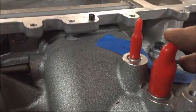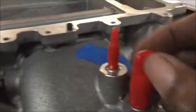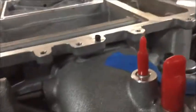Let's recap. You're going to leave this, you're going to cap this off — cap that off. This is for the oil catch can. This you're going to leave open. This attaches to this — the hose goes to here. Now don't forget these two right here: this is for the brake booster, you put your brake booster here.